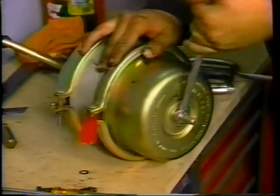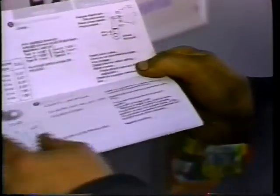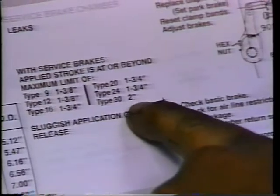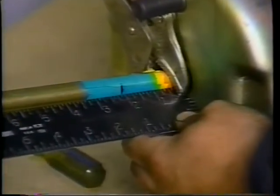Once the S-cam is in place, prepare to install a double diaphragm spring brake, which Midland calls a go brake. First, cage the spring brake. Now, set the maximum adjustable stroke — consult your Midland troubleshooter's guide for the proper travel. This Type 30 chamber requires a 2-inch maximum adjustable stroke. Mark the pushrod at the chamber housing, pull out the 2-inch travel, and lock with vise grips.